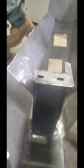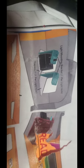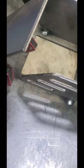I'm getting ready to tack the inner mounts. I left these loose and haven't welded them yet. Once I weld them I'll pull the bumper off, get the winch mount welded in, and cut the light holes. Got the bumper set on the ground and tacked the mounts on once the bumper was straight. Got the winch mount in — I centered it up. Now I'm working on the pod mount. I personally feel more comfortable with the light sitting on the mount rather than hanging on it, so that's how I'm doing it.